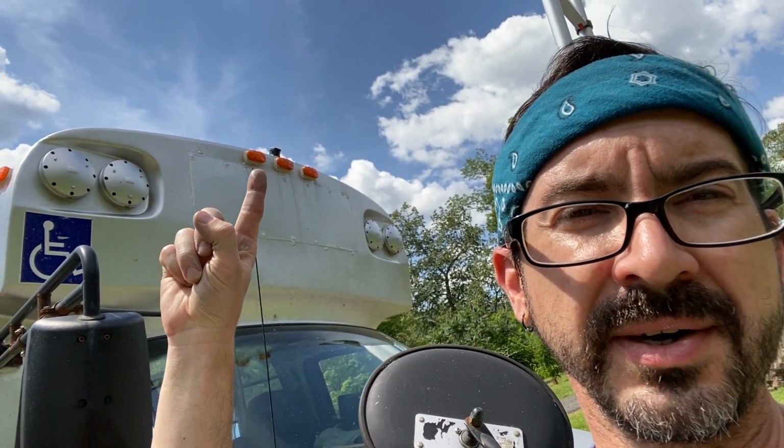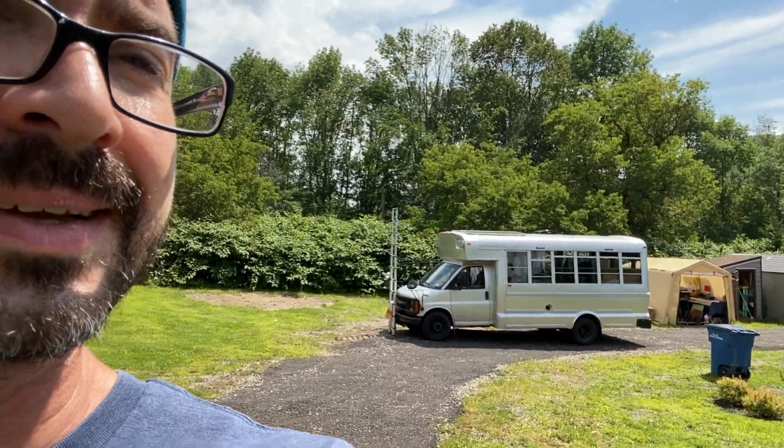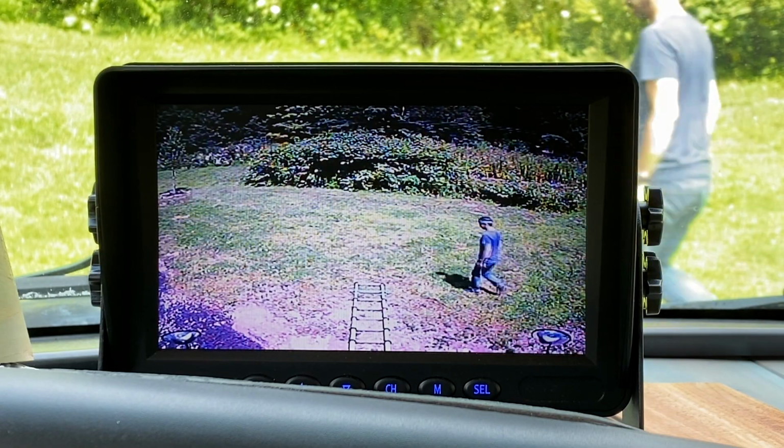And that's what we ended up doing. I threw him up there just a little bit ago, and right now I'm doing some testing so we can see. I've measured out on our ladder here. That top rung is 9'8", and 9'6" are the two marks below it. The vehicle stands about 9'3", plus I gave myself a little bit of extra height for the Max Air fan bubble. So I've just been testing this out and seeing how the clearance goes. I'll give you a look at how things look through the camera.